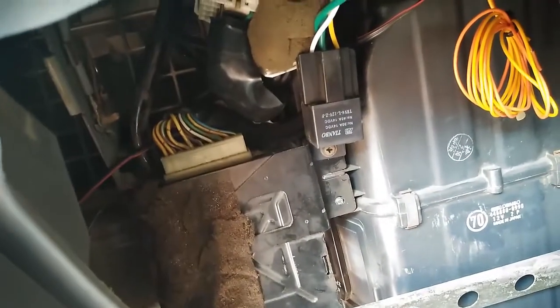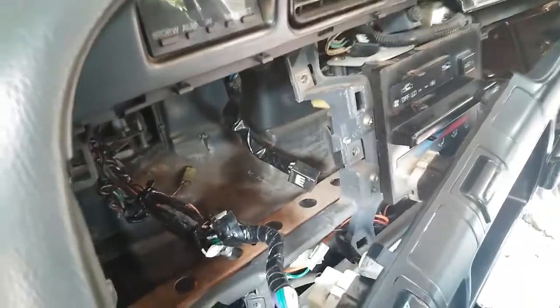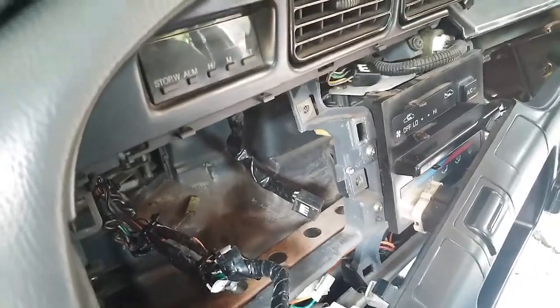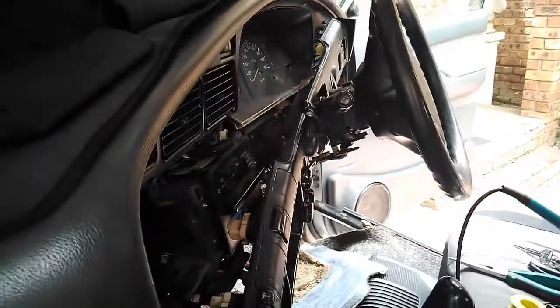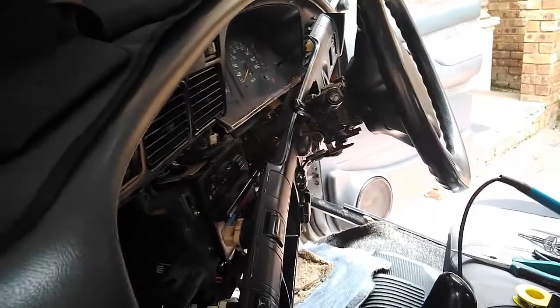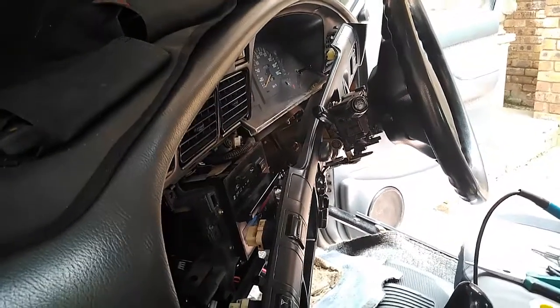One other problem that I discovered in PE actually, while installing a tracker unit into the car, is I discovered a burned earth wire. And I traced the earth wire from the plug just underneath there, the main plug going through to the engine bay, the wiring loom. I traced the earth wire back to the earth connection on the back of the cylinder head. And I couldn't fathom out how this wire could have been melted until it struck me.